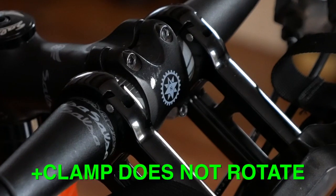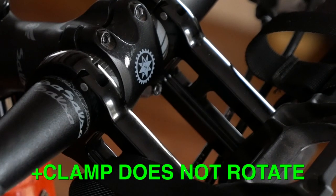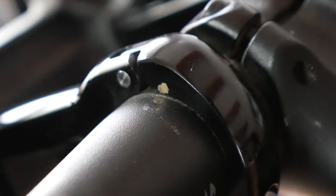In this video, I'm gonna tell you the things I like and dislike about the Anything Cradle. Starting off with the first big like: it actually holds on fairly well to the handlebar. You would expect that with a load and the long arms cantilevering the weight in front of the bike, that when you hit rough terrain it would slowly bounce its way down. But to my surprise, with light to moderate loads — I'm talking like three to six pounds in the front — there's enough clamping force and friction to keep that from happening. On the rough trails and single track I've ridden so far, the rack itself has not moved. I've put a little magic marker line so I can see if the arms are tilting, and so far they've stayed put, which is a big surprise.